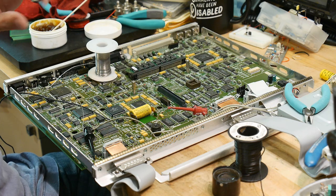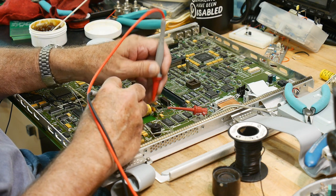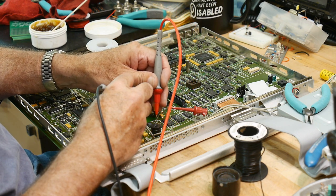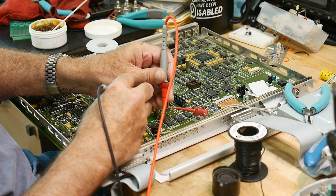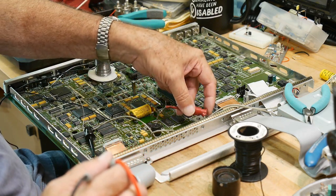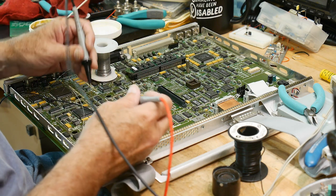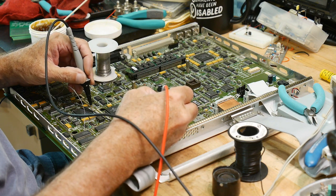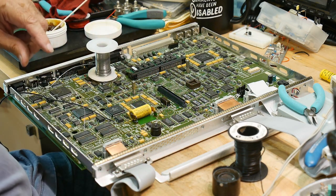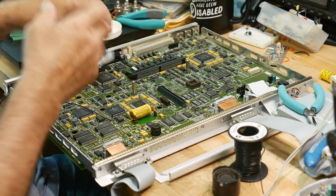Let's measure voltages and make sure everything is okay. Measuring the voltage across the battery — look, my hands are shaking — 3.35 volts. That's very good. My backup battery was 3.2. They don't match, which means the new battery is the one supplying the voltage. Down here: 3.3 here and 3.2 here. Good — the battery is taking over. Battery looks solid. Taking off the backup now. Measuring the voltage again — moment of truth — test point reads 3.35. Excellent. Battery is 3.35. Everything is in. Let me remove the 1K resistor — don't need it any longer. Process complete.